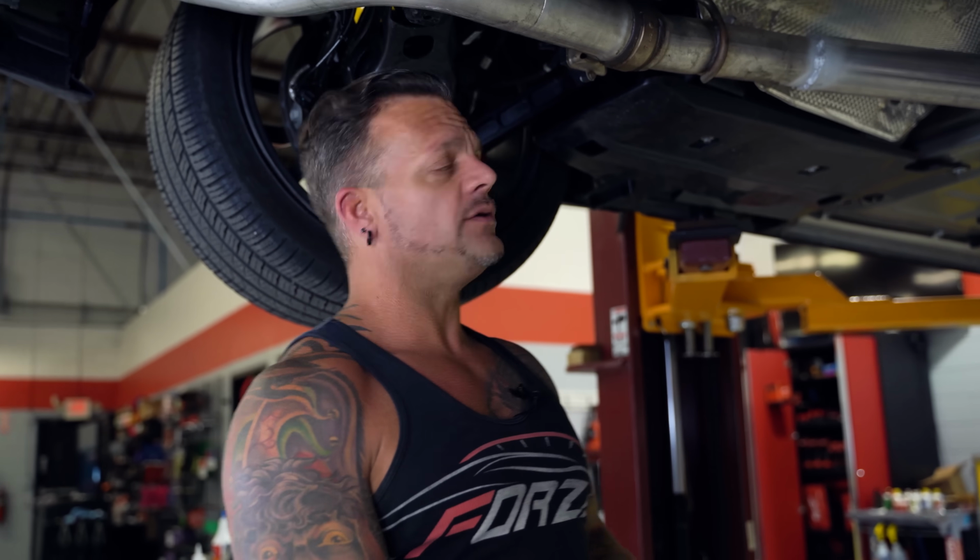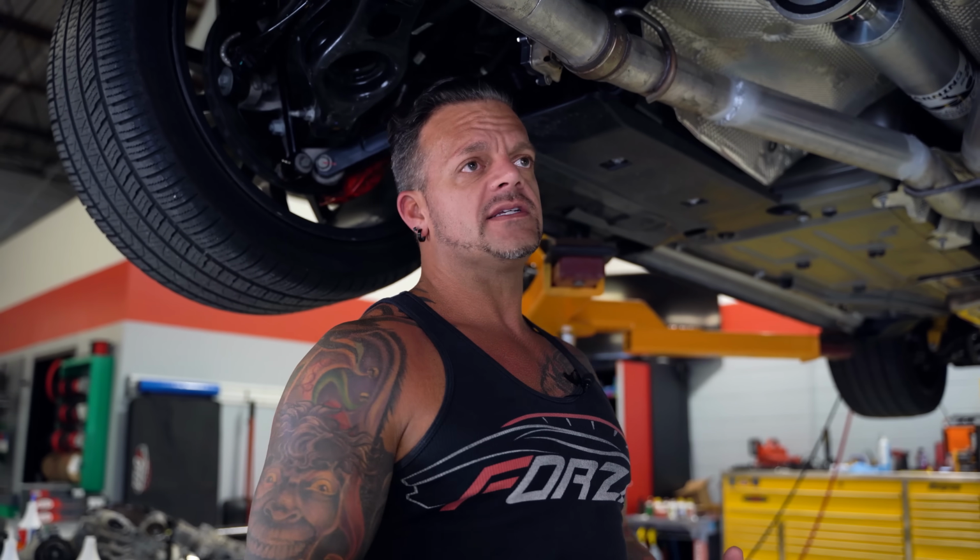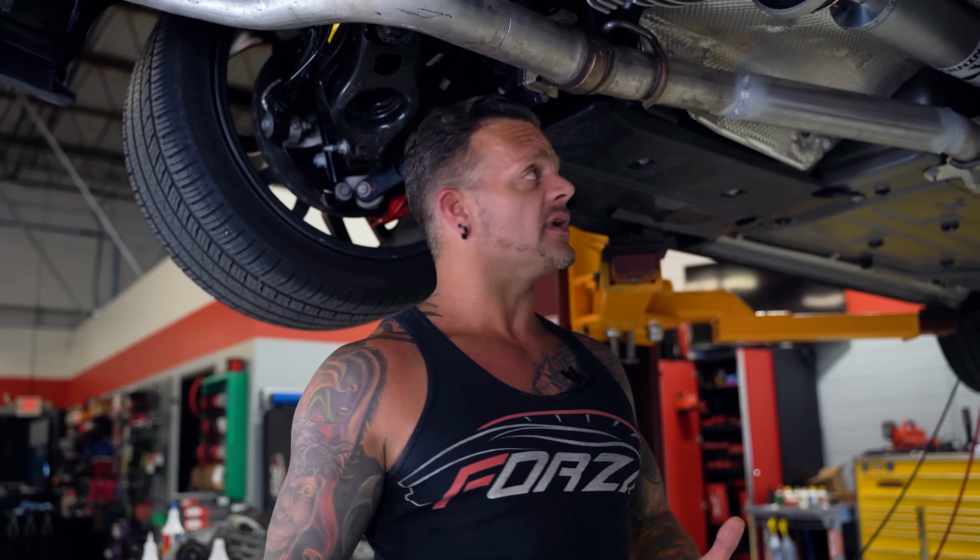This is not a lightweight car, so the weight difference between the two is kind of irrelevant to me, but you can get whatever you want. We also offer an Alcoa 7 two-piece drive shaft that is torque tested to 1,500 foot-pounds. It is basically unbreakable. It is super nice, but it is 3.5 times the cost of the one from the Drive Shaft Shop. So at some point you have to weigh out, do you really need that or do you really want to spend that, okay?